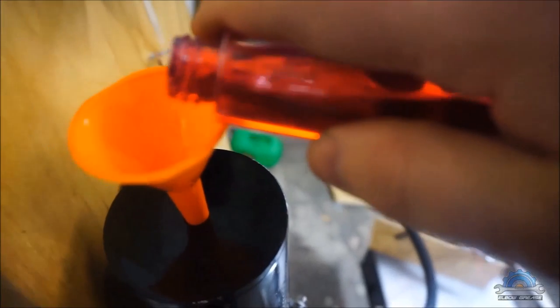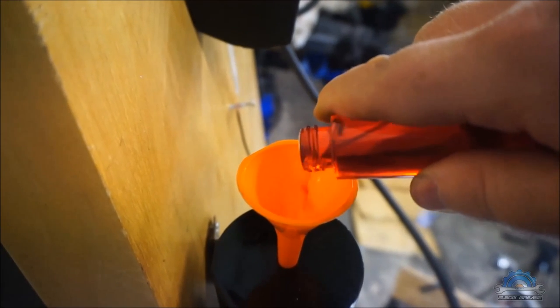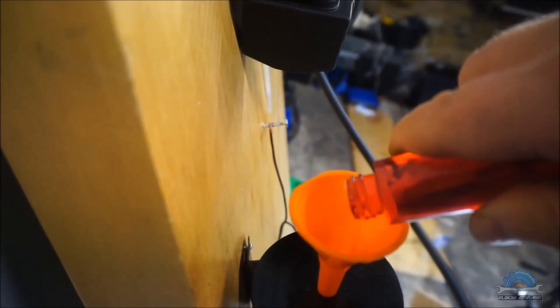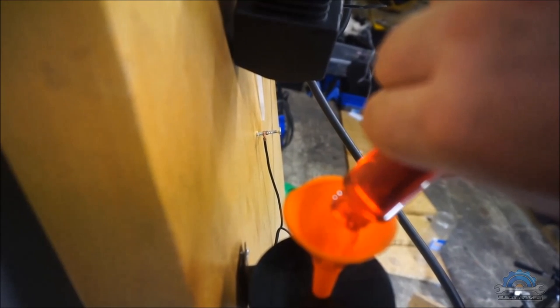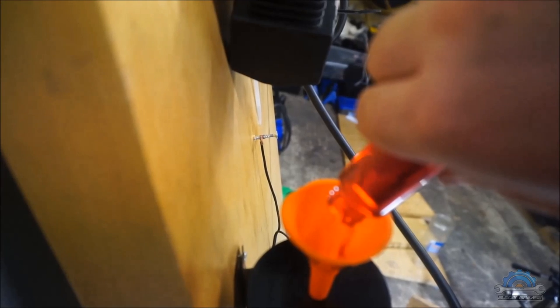So now I'm pouring the cleaner in with fuel. I decided to add more of the cleaner to save my time. Anyway, I'm doing this DIY. I'm not sure if these cleaners will work or not. I just want to lower the cost to a minimum, and also my time. That was the goal. So, loads of injector cleaner. The ratio is very high. It's probably 1-to-1 or even less.